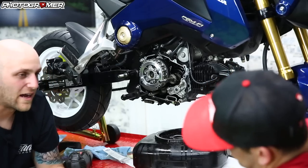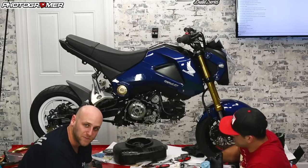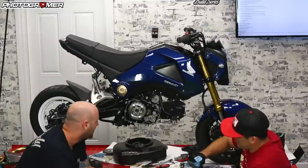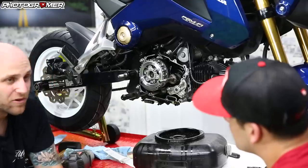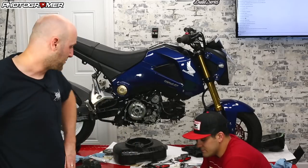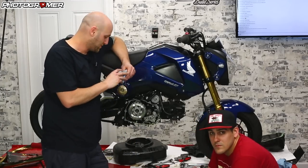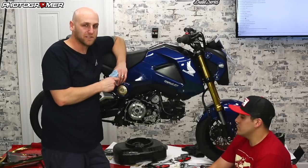I don't even know what to say about it. I don't know what to say to you guys because if you guys are working on your bike, you're going to experience the same thing — you're literally tightening this down and then it snaps. So be ready to experience this stuff because it's pretty frustrating. In theory, you should be able to tighten these bolts, have them hand tight, then torque them down to nine foot pounds, and at some point it should stop — it didn't.